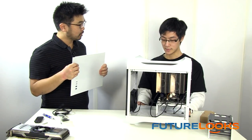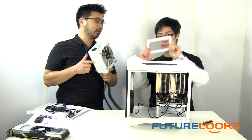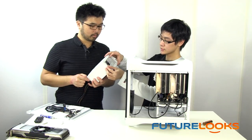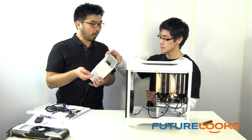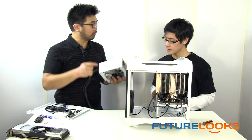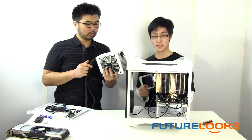Let's try and get the power supply in and plug everything back in. This case uses a different mounting mechanism — there's a power supply bracket. You just place the PSU on here, screw it into the brackets, and slide it back in. You would obviously do that after you have everything assembled since there's not a lot of room. You need a power supply within a certain size range. Unfortunately, I think this power supply is 180mm and the PSU cage is also 180mm, so we should be looking at a smaller power supply — probably 160mm or less.